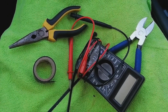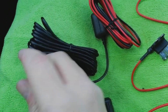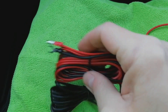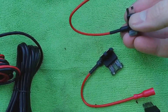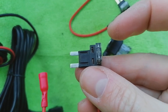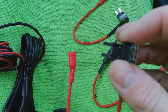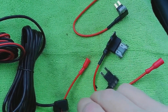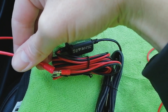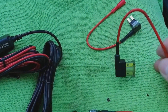So what do we get in the dash cam hardwire kit? We get a replacement power cable terminating in mini USB on one end, and on the other end a power lead with a bullet connector and an earth with a spade connector so you can put that to a chassis earth. You also get fuse spurs, which are basically doublers for a fuse socket — you pull one fuse out and it doubles it into two. One output runs the camera and the spare socket is to put the fuse back in that you pulled out of your fuse box. The other end has a female bullet connector to plug into your power cable. On this car I think it's a mini fuse — I'll check shortly.